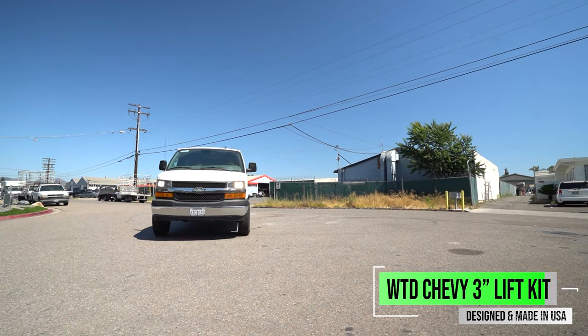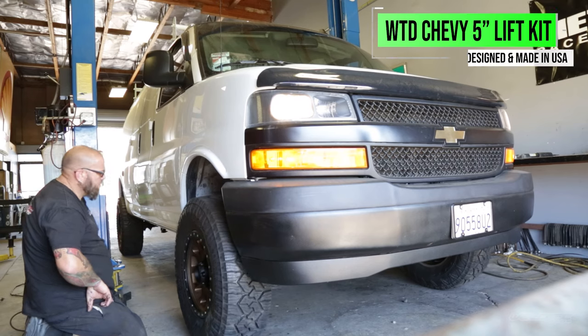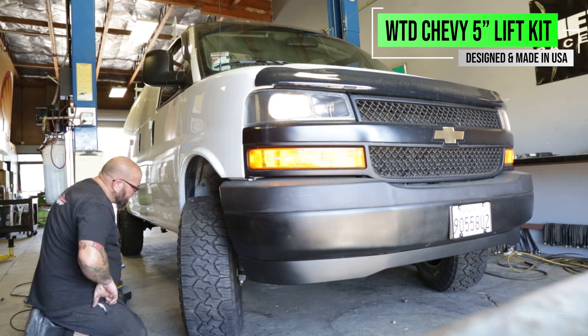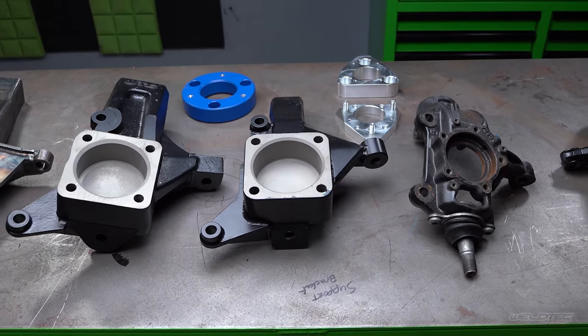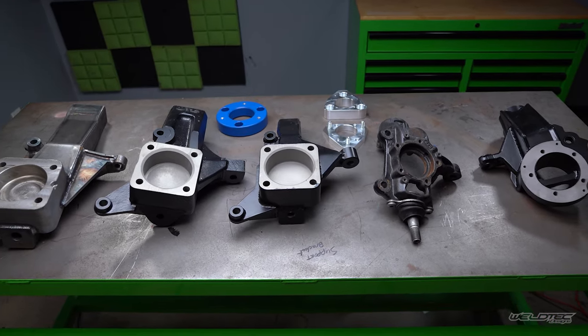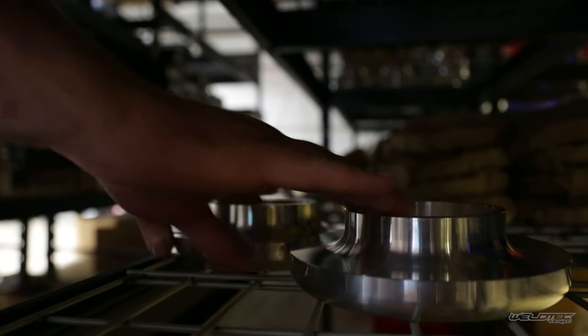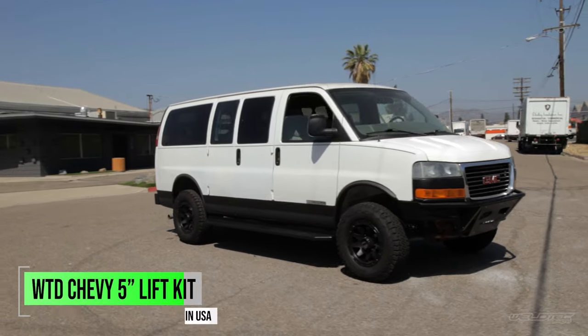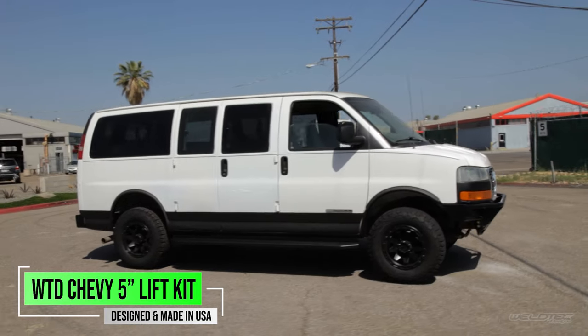It's like working together with your suspension. Another thing it's also going to do is increase your track width by three quarters of an inch. Spindles and coil spacers come in all different forms or types, and it's going to be the same kind of characteristics across all of these vehicles. What you can also do is add a two-inch spacer to your three-inch spindle and now you've got five inches of total suspension lift.